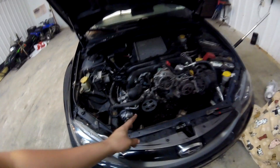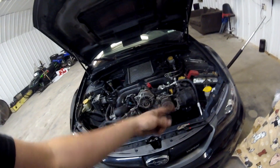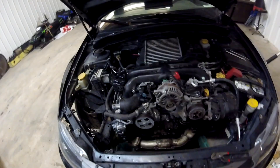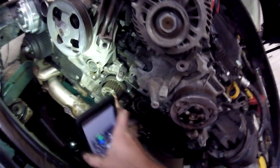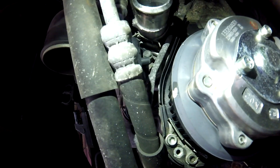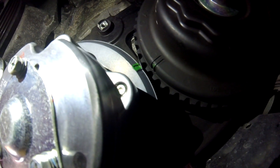This thing is a little tricky because there are two idlers on the passenger side of the motor, a tensioner, and another idler on the driver's side, so the belt has to go through a whole bunch of weird hoops around all the idlers and crank pulleys. What I did was take the timing cover off and turn the engine to TDC. There's a mark on the crank that lines up with the oil pump, and a white line that lines up under the crank sensor notch. Keep turning until all the marks line up — the passenger side camshaft goes straight up with the valve cover notch, and the two dashes on each cam need to line up together.